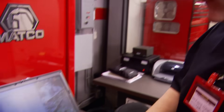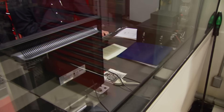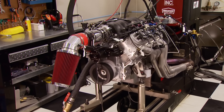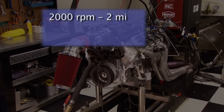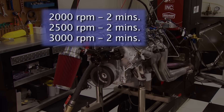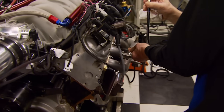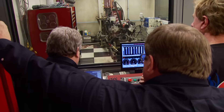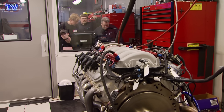This technology has far-reaching benefits - OEMs have been using it, the EPA has been using it for their own road tests, and it behooves specialty parts manufacturers to be looking into this technology for evaluating their products for emissions and fuel economy. We'll get data from the competitors' plugs first. Since this test is all about real-world driving conditions, we'll run the engine at 2,000 RPM for two minutes, then 2,500 for two minutes, and finally 3,000 for two minutes.